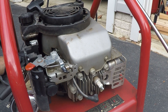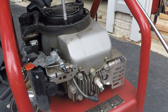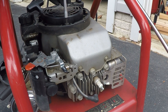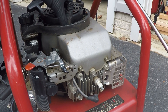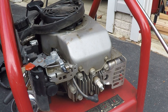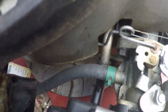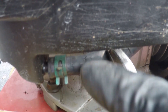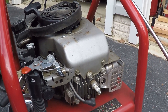It's missing this bolt down here, and the bushing. Clearly whoever took this tank off before to try and fix the leak forgot to put that 3/8-inch bolt back in on the bottom. I'm looking at that fuel line in there and it's pretty cracked. I think I'm going to go ahead and replace the fuel line while I'm at it. There's no point in putting a cracked fuel line back on.